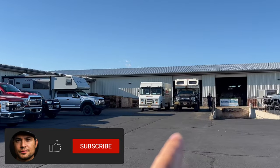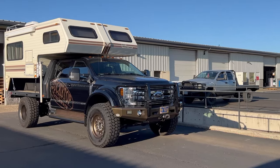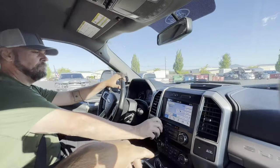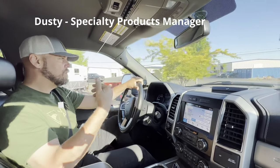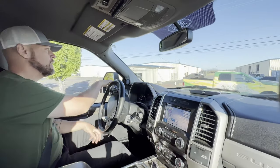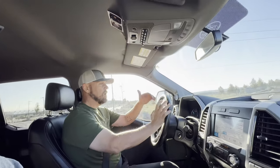This is the 550 with the truck camper on it — that's the one we're going to test. It's got liquid spring, a 2-inch front lift, 4-inch rear, dual steering stabilizers, and all the skids on it. This particular truck doesn't have a sway bar, front or rear. The liquid spring kind of compensates for that, so you don't need the sway bar.